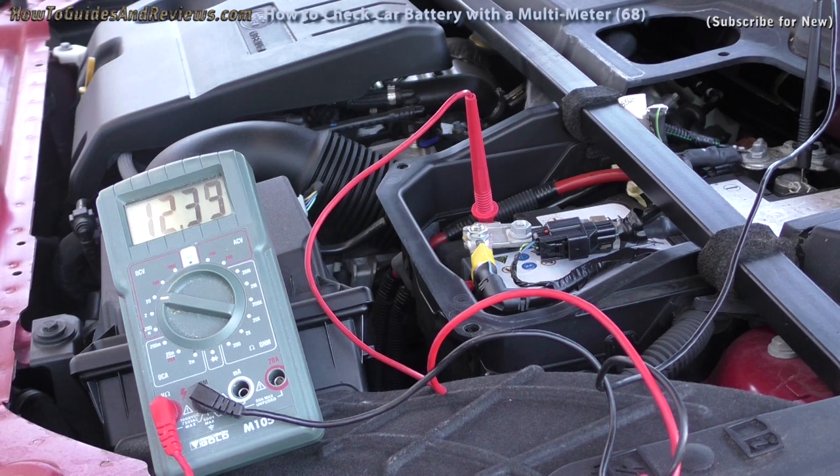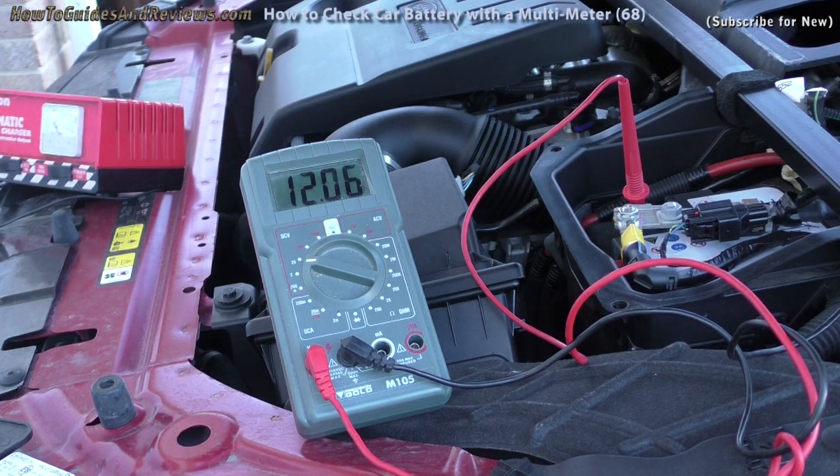Just need to turn the engine off. It dipped back below 12.6 pretty fast, going lower — it's gone below where it was. That's the effect of starting the engine drawing a lot of current. It settled at 12 volts. Replaying the footage shows the voltage did not dip below 10, so this battery is good.